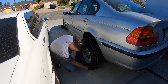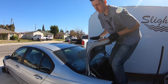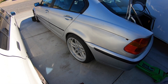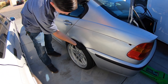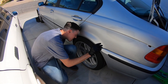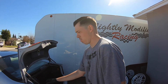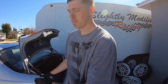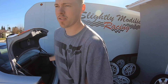Another E46 on Empires. I can see exactly where it hits - right here on my zip tie job. We're going to need to go in there and shave that. We're going to need to roll the fender or cut it, but I think we should just roll it because it's got some tire poke. If we roll it, it'll kind of get rid of some of that tire poke. The rear is good - we just need a little bit of roll. Let's get to the front.